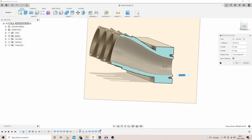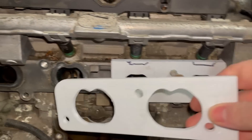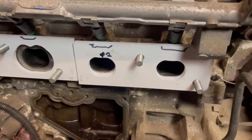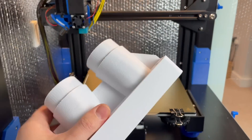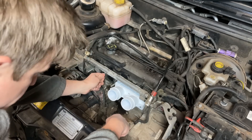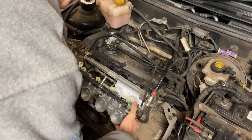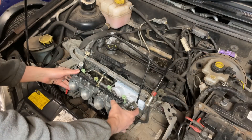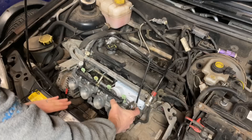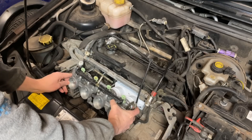Once we're generally happy with the model we print off just a thin section of the flange and offer it up to the engine. There are a few mods needed — there's a little lip on the port that's a problem — so we get busy with the hacksaw, do a bit more marking up, and get an updated design. Printing out a trial half in PLA, offering up the inlet manifold to the ITBs, we've got just enough clearance to the alternator, we'll be nicely inside the bonnet shut line, and there's enough room to route some air in. Happy with that — sorted.